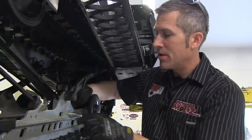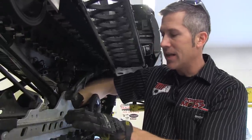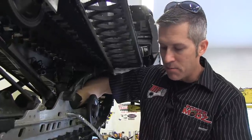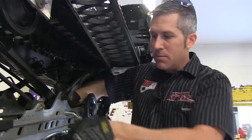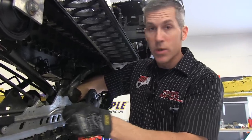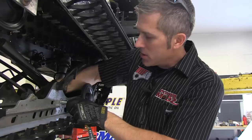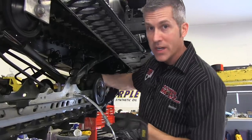Just like everything else you do to your snowmobile, make sure you come back and check these often. You want to make sure it hasn't hit something, it hasn't rotated up, make sure this hasn't come off or loosened up, because if something like that happens, it could get caught on the side of your track and you could run into real issues. It might wear your track down and make the bars show, and we don't want that happening. So just come through, check all the bolts, make sure everything's tightened up, and that way you won't ruin your nice day of sledding.